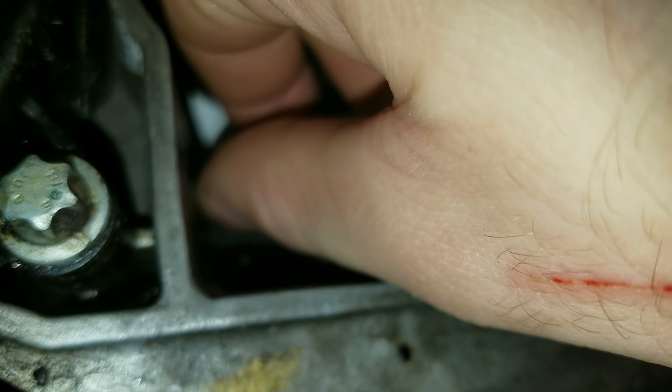If you don't want to replace the head, it's over a thousand dollars. So it's threading nicely by hand. You want to be really gentle because it needs to be totally clean of any fluid, because if you tighten it down it can create hydraulic force and break your really thin aluminum head.